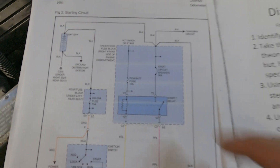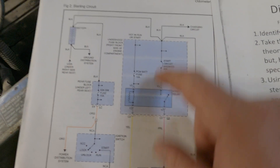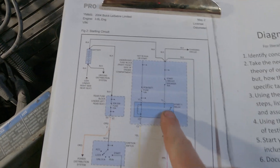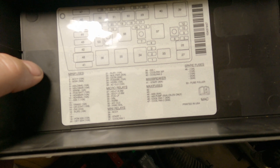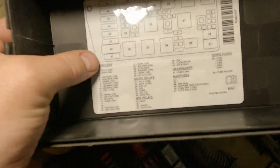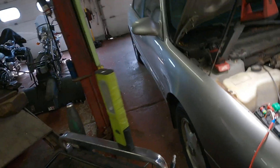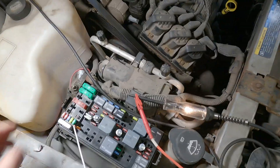Back to the diagram. We're missing power on this leg because this should have power even with the key off — it comes right from the battery. So we're going to go to the start circuit breaker, which according to this is number 41. We don't have power because the circuit breaker is not there. Let's put our circuit breaker back in — and we have power.